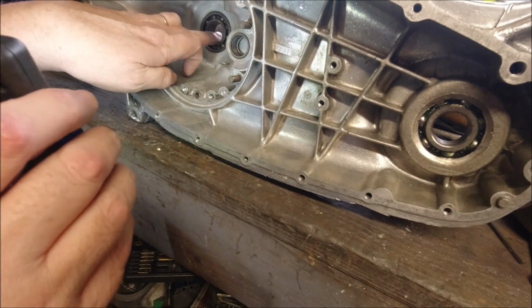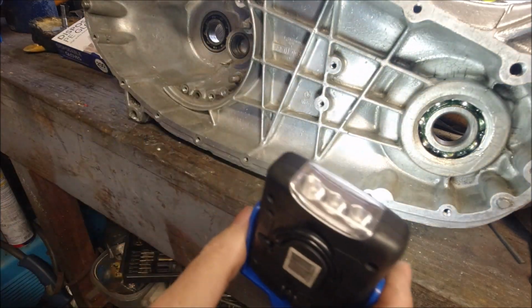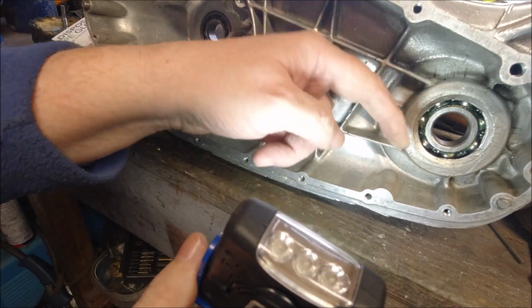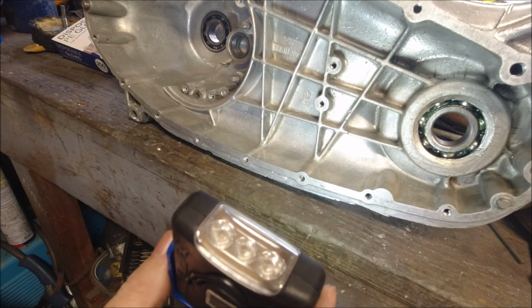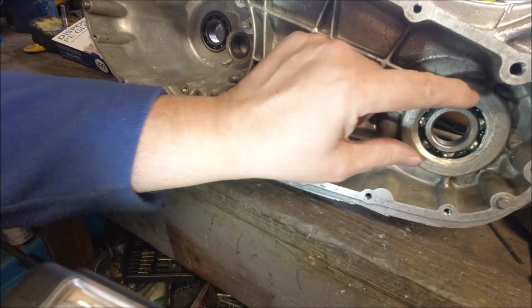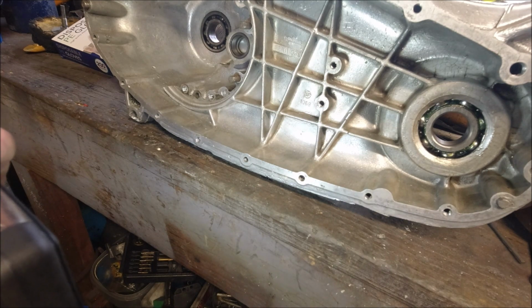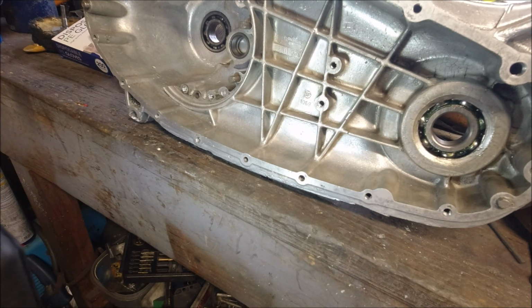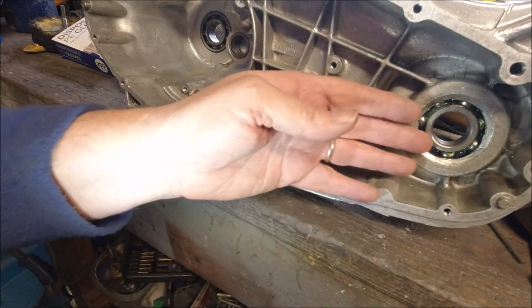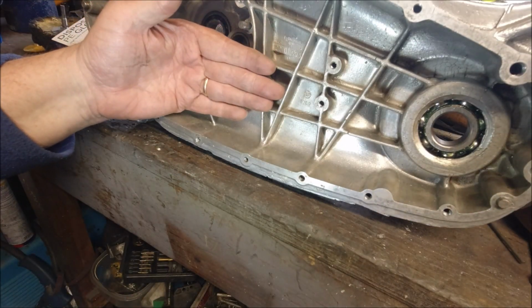I'll show you taking out the bearings, how to heat up the crankcase, take out that one, what's behind the flange that holds it in. There's a gasket in there, there's an oil thrower that goes inside it. It's like a dish. I'll show you bit by bit. I mean, a lot of other videos that I've watched on YouTube myself, they show you this and next minute it's got the gearbox in and it's got the crankshaft in. They don't show you how to level up the chain.